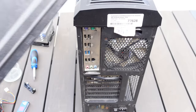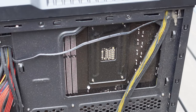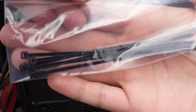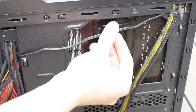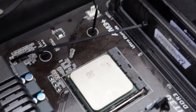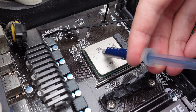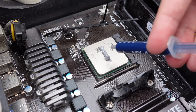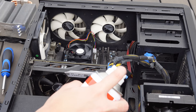You can see where the mounting bracket for the CPU would have been, and that's how we're going to attach this new CPU cooler. We're going to be using cable ties as our interesting attachment method. We put a cable tie through and attach another cable tie onto that to make it longer. Now we can add probably more thermal paste than you need, then secure the CPU cooler on with the cable tie and the other part of the mounting bracket. I'll give it a quick clean with some compressed air to clean off some of the dust from the graphics card.